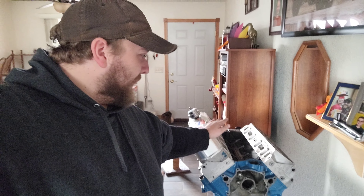So I'm testing it with the tunnel ram right now, because I really want to run the tunnel ram. We have a little gap underneath, which is perfect. That gap will expand as we put gaskets on here, so that's fine — we want a gap. We don't want a gap up top though, and that looks to be perfectly in line. I would say, once we put our gaskets on here, this tunnel ram is actually going to work for this block.